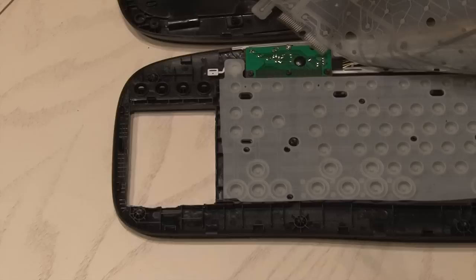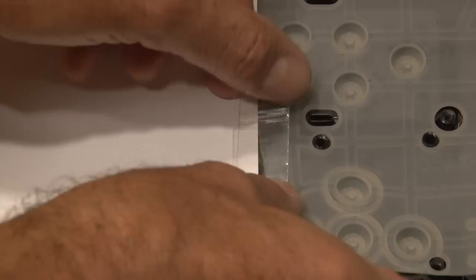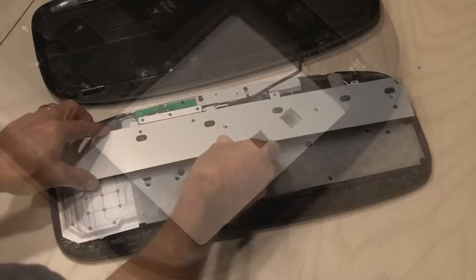We're going to need a base inside the keyboard, so I'm using a piece of cardstock that will fit over the hole we just cut out in the keyboard base. I'll securely tape that in place so it doesn't go anywhere. Then using a razor blade, I cut two small squares for the little notches that the keypad will fit in. Then we can lay the circuit board sheet back down, secure that additional shield, and start putting the keyboard back together.